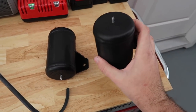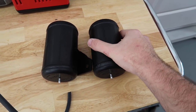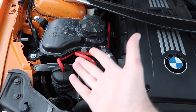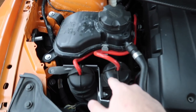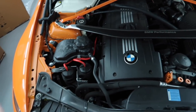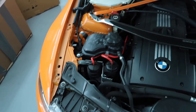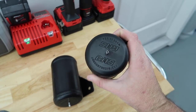Burger Tuning designed these beautiful vacuum tanks that replace your factory stock plastic ones. They sound absolutely amazing and look absolutely amazing — it's definitely going to look way better inside the car. It's replacing the two plastic tanks that can eventually melt because of heat. If you have a bunch of upgrades and create more heat, those could possibly melt or crack, which will cause a vacuum leak and you'll get the 30FF code. The 30FF code is notorious, and sometimes these can get a very thin crack that you'll never actually see unless you have a smoke machine or go through diagnostics. So to avoid all of that, you can just get the Burger Tuning vacuum tank upgrade.